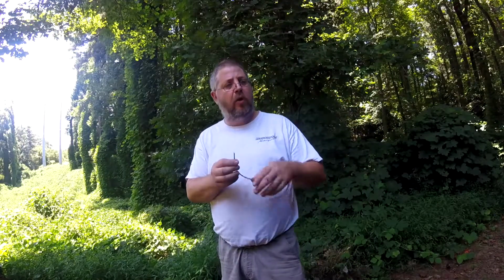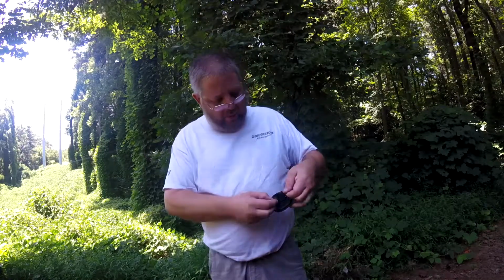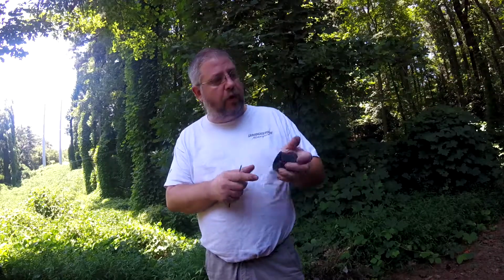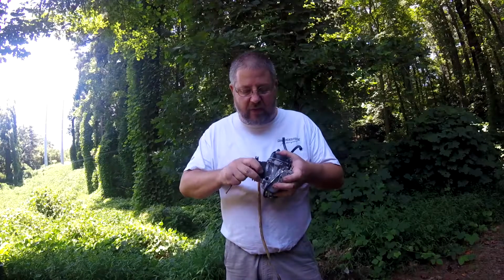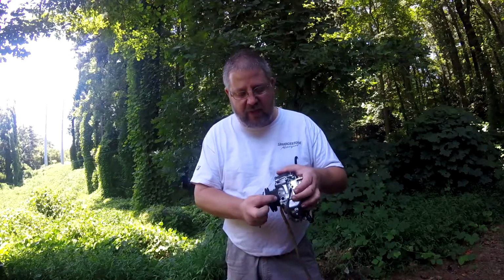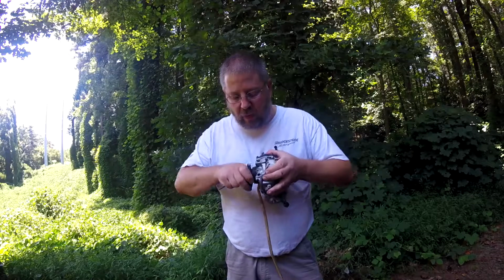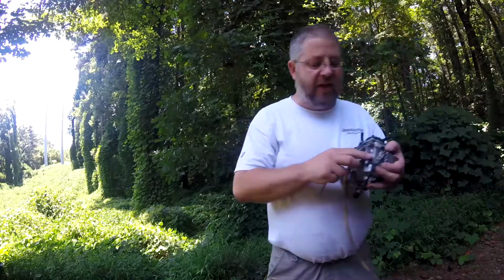There's been some debate through the years on the best way to handle these little springs that go on the manifolds, okay? It's very, very difficult to stretch them on and hook it in place. You don't have room to work in the airbox area. Then once you get the carburetors in and get these pushed up on them, and even if you do, look at this old nasty crusty one. I can't even get it on the carburetor without forcing it. Now that it's on there, yeah, see? Now that I forced it, look, it's not sitting straight. See that? More evidence of why I had to replace it. Even when I got it on there, it's still not holding a good circle. It's not going on and staying on all the way right there. But the nice brand new fresh ones will.